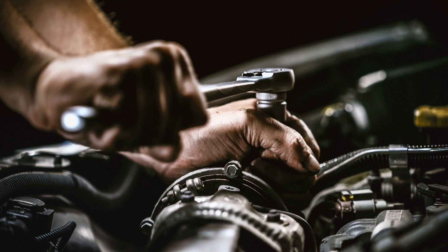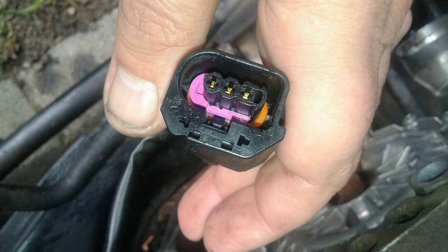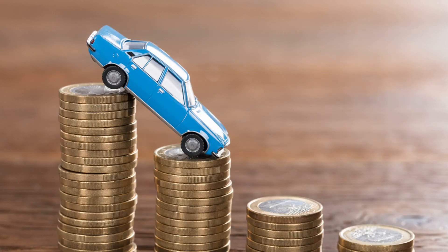There are two types of crankshaft sensor. First, inductive TDC sensors — these consist of a magnet and a coil which create an electromagnetic field. As the flywheel teeth pass the sensor, they create an electrical signal that tells the ECU the speed and position of the flywheel. Second, Hall effect TDC sensors — generally found on the latest generation engines. They operate in a similar way to inductive sensors, but electronically. When a flywheel tooth passes in front of the sensor, the current is disturbed, creating a hall effect. Hall effect sensors are more expensive but also more accurate, especially at low engine speeds.